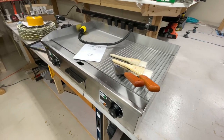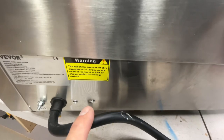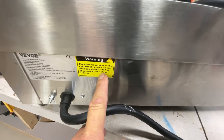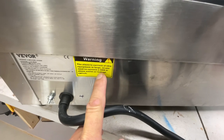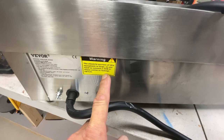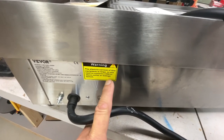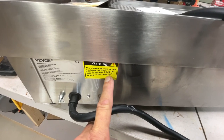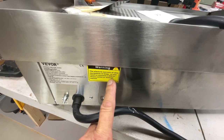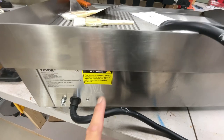One of the reasons this is not for home use: unless you have outlets in your house that are at least 32 amps, it won't work. Most residential breakers are 20 amps at the most. I even tried running it off my washer circuit — it turned on, but once it started drawing more than 20 amps it popped the circuit breaker. You have to have something that's 32 amps.